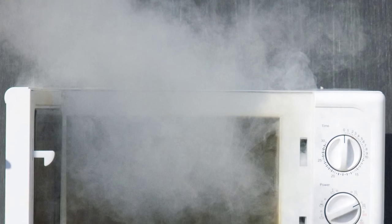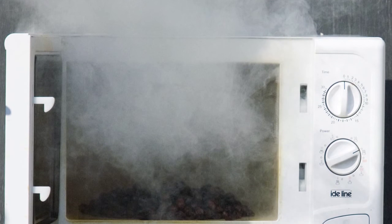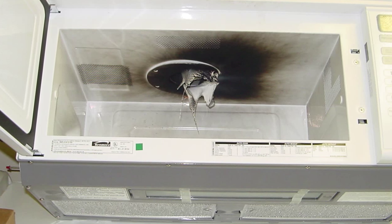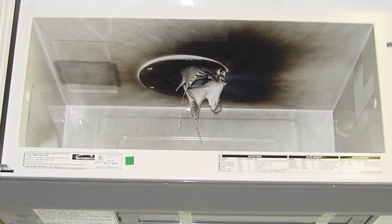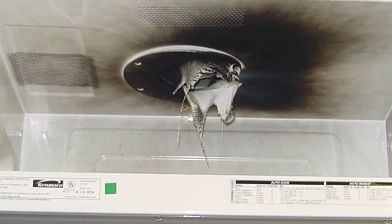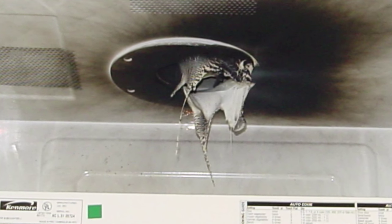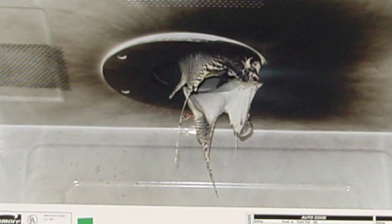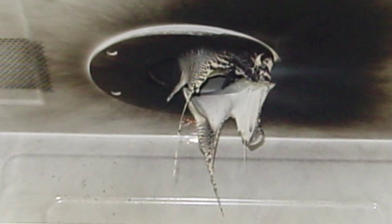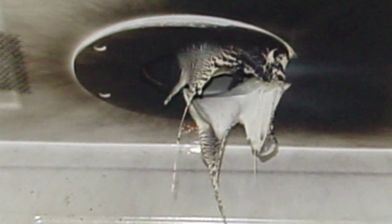However, there is also the potential that this ends up creating a sufficient charge density that the electrical potential in the metal object exceeds the dielectric breakdown of air. When this happens, it will result in arcing inside your microwave, from that metal to another electrical conductor with lower potential, often the wall of the microwave. In extreme cases, these electrical sparks can end up damaging the wall by burning small holes in it. It can also end up burning out the magnetron in your microwave oven or, in modern microwaves, can provide a surge that ends up damaging sensitive microelectronics, possibly killing your microwave or making it unsafe to use, in the case of a hole in the inner metal wall.